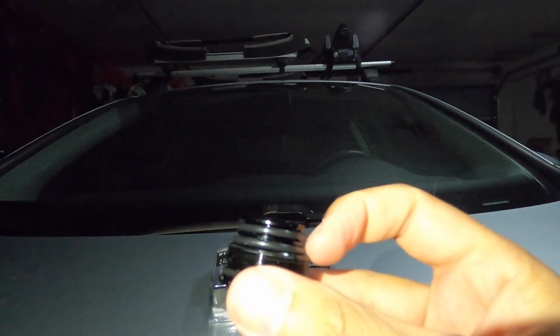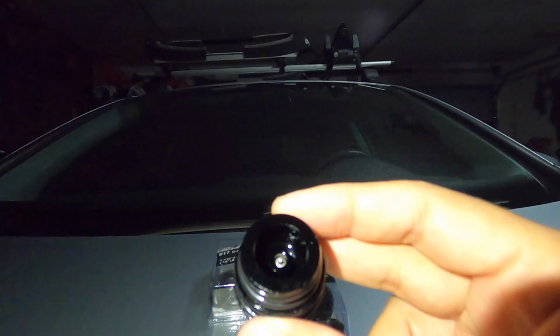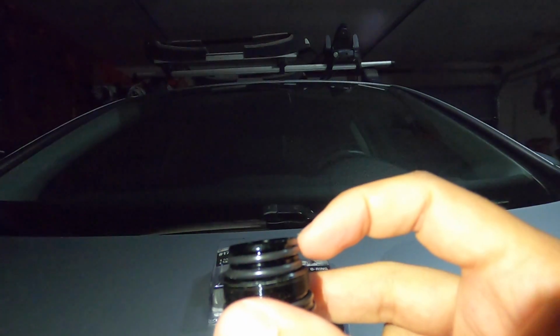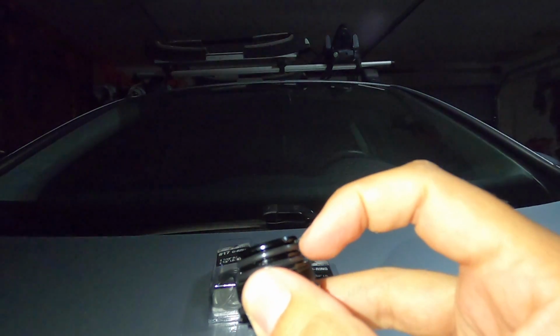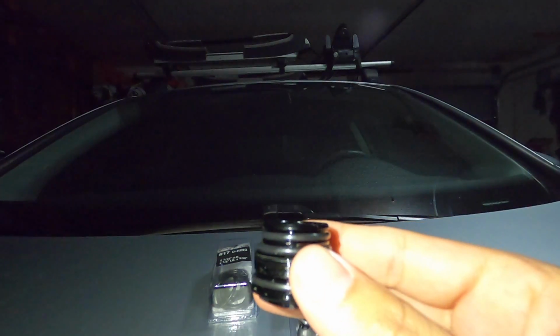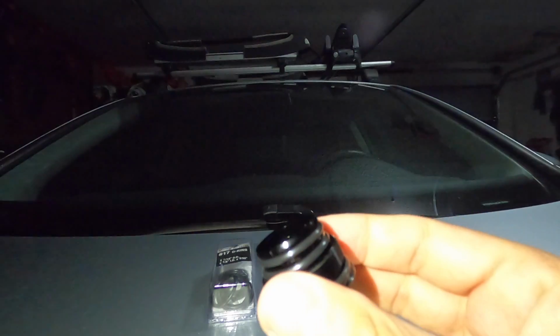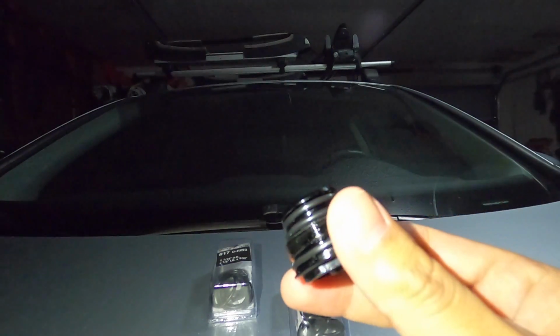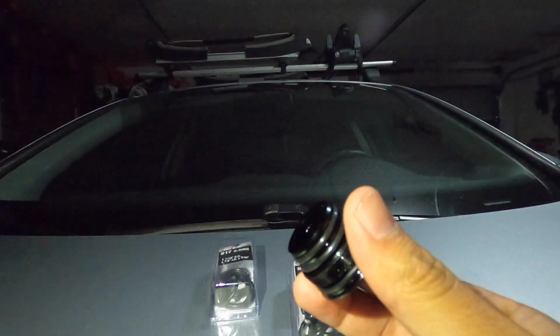As you can see here, if you saw in the previous shot, there was no O-ring here. The second down, this space was empty. So I put it right here. Now in diameter, it's a little bit wider than the top one. From what I read, you want to put a slightly bigger one at the bottom than the top. That's going to reduce the clunking, I think. I'm hoping. I'm going to test it. If it doesn't work, we'll go from there. But this is what I've got right now. I'm going to go ahead and reassemble.